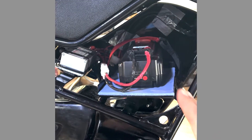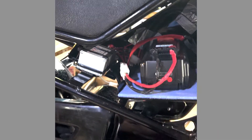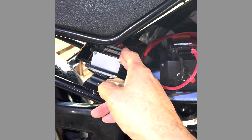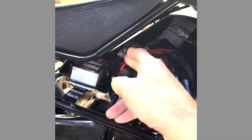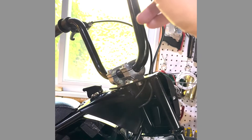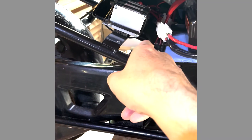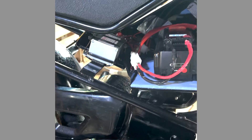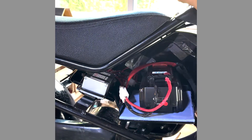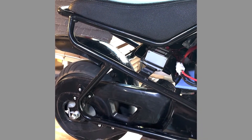So in short, you have to make sure that your terminals are correctly aligned, or you will fry the box. Power goes into these connectors, into the box. There is a connector back there that goes up to a kill switch, and a connector up here that goes up to the throttle. There's one connector that goes up and underneath to the motor, and that's what powers the motor. So basically, turn on the power, give it a little throttle, and you're good to go.